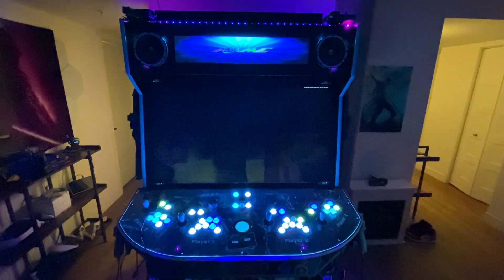Let's go to LED Blinky. If you have an iPac Ultimate for players three and one and a second one for players two and four, you don't have to do anything — just activate it. 'LED Blinky on,' boot Retro Beast, and let the magic happen. It takes a few seconds to really load. If you go to MAME right away it takes about 20 seconds to finish the animation. As soon as you move the controller it will jump to the system's color. If a system doesn't have a preset color it will fall back to the default.